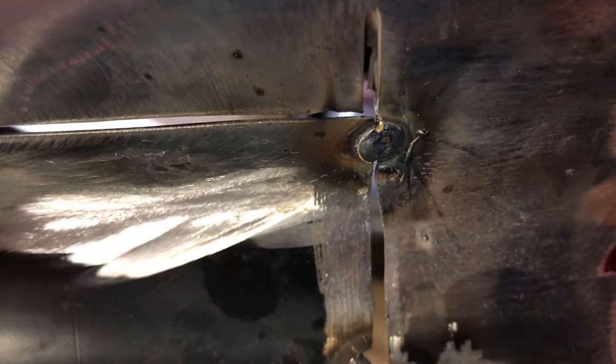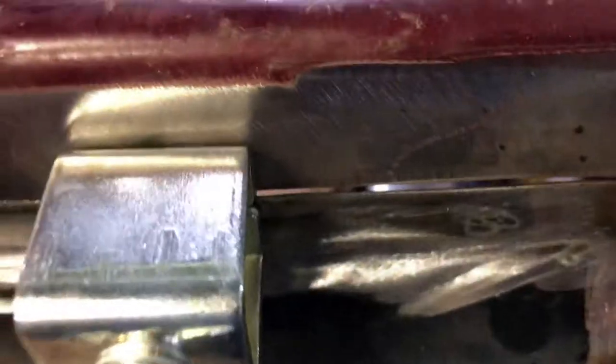And then I went down here and put me a tack there, which is pretty good. I've got way too much gap down here. It's going to require some work. Just my clamp. And then my last weld I just did was that one there. And I'm trying to get a picture of my penetration. Looks pretty good. And I just really can't see those. But anyway,